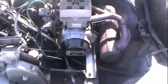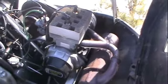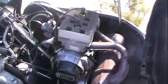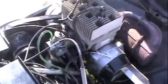It was the last set they had, and they had been sitting there for five years. It's like the last coils in Manistique, Michigan. The problem with finding coils for this machine was this is a Kawasaki motor. Somebody put this motor in this machine before I got it, and it was not original equipment — they put this motor in as aftermarket. So every time I tried to order coils for it, they kept giving me the wrong ones, or they're outrageously priced. Turns out these are fairly common and pretty cheap.